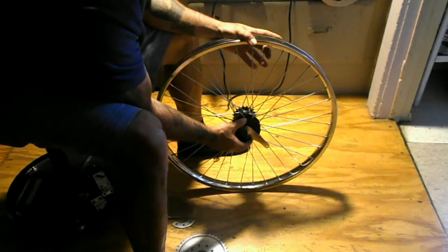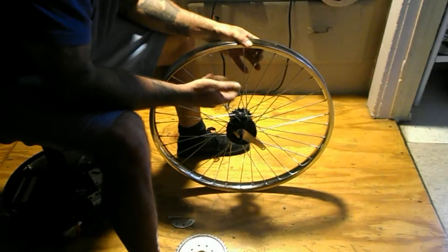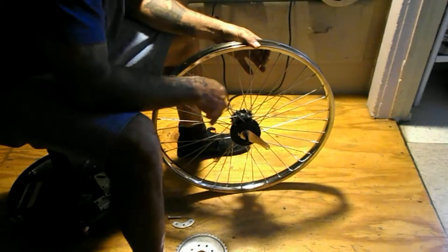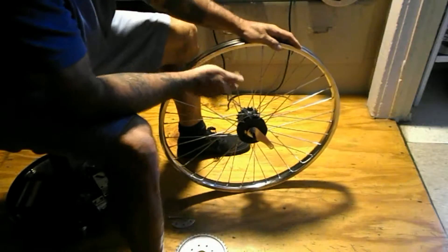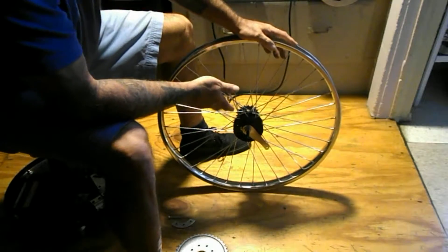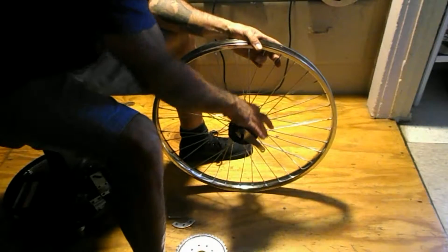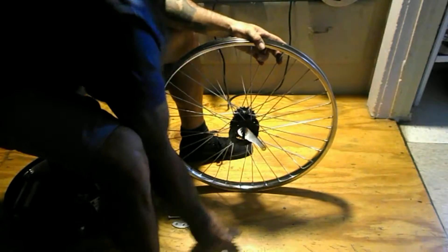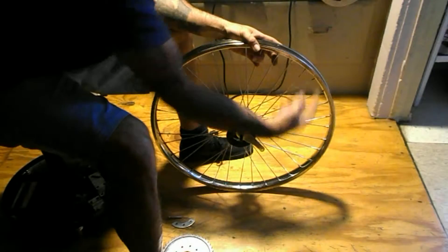The whole point is that these two rubber rag joints are driving the whole thing forward, and there's really nothing you can do about it. If you over-tighten, you strip out the bolts; if you leave it too loose, you shred your spokes. These are brand new wheels — expensive ones — and it's not easy to replace one of these every couple of months. So we discovered a new setup: a hub adapter that bolts over the hub with three bolts and has an adapter plate.